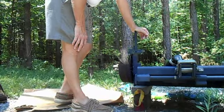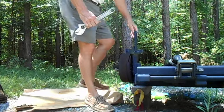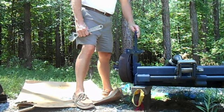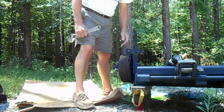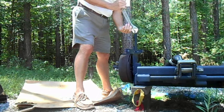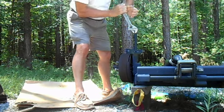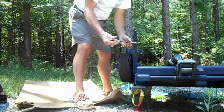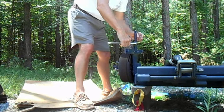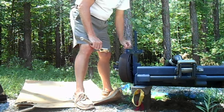Okay, we're back today. Try to straighten up this bracket here. It looked like it was bent some, probably from me pulling on it some anyway. Plus the fact when the tire blew, probably pushed this back some. It looked like it was angled back a little bit and raked some. This is a trick about using a big adjustable. Also sometimes you want to bend in a certain spot, you put it down there, put another adjustable here, and can bend it if you have it bending at the wrong place, which this looks like it's doing an okay job.